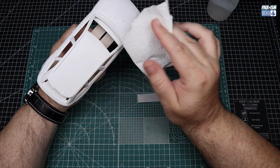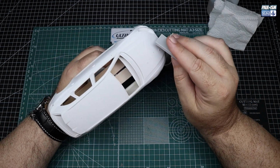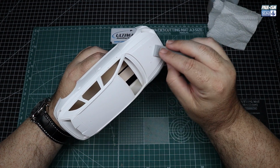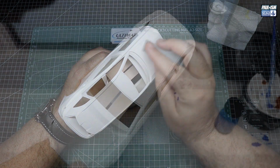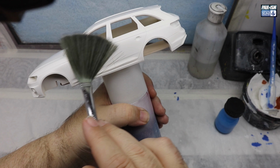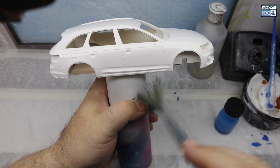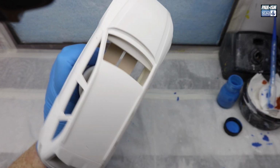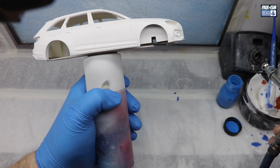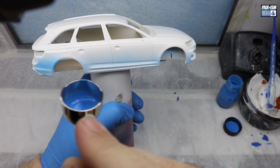And then drying it off with a clean piece of kitchen towel, gently. Don't go too mad on your high areas or your edges, because you burn through and you're going to have to reprime. Just take your time. It's exactly the same kind of pressure as when we're keying the butt paint. So silky smooth now, beautifully smooth. We've got the toothbrush and the panel lines again, and we've got our anti-static brush on there to ensure that nothing nasty gets caught in our paint.